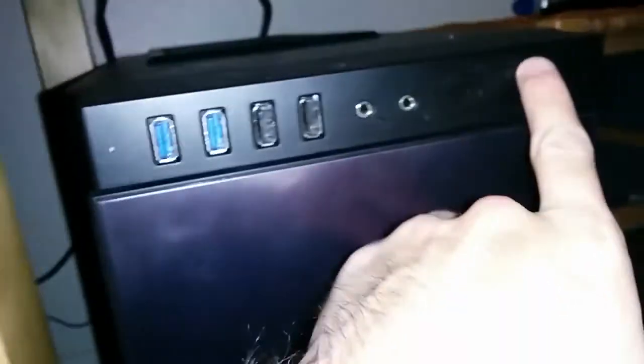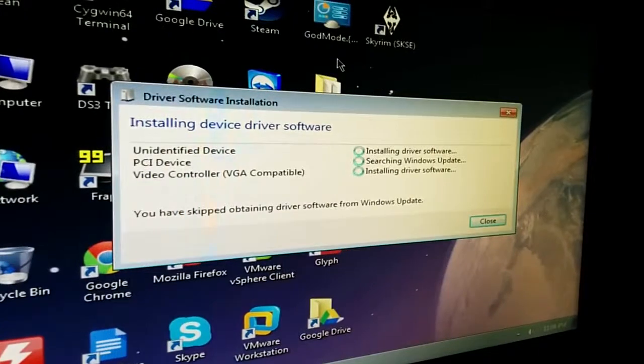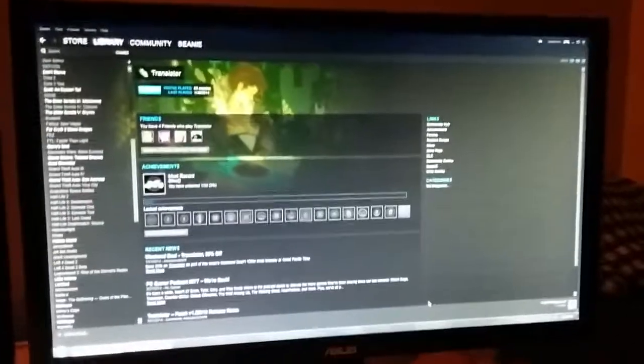Once you've got your card seated, screw it in. You would normally replace your slot blanks too. I'm not leaving this card in permanently so I'm not going to replace the slot blanks or put the cover on, but putting the cover on is really easy. Now spin the machine over, power it on, and check to make sure the fan on the card is spinning — which this one is. Let's see if the computer posts. I've got the card installed and the monitor plugged in. If it spins up you should boot into Windows and let it install your drivers.